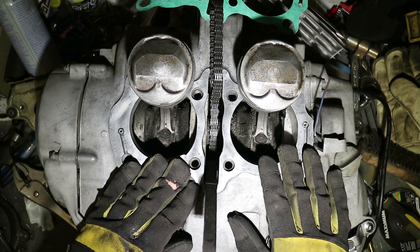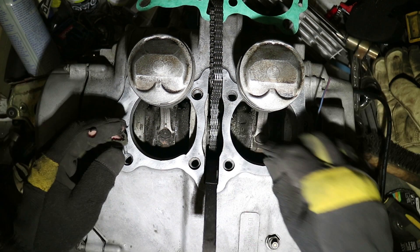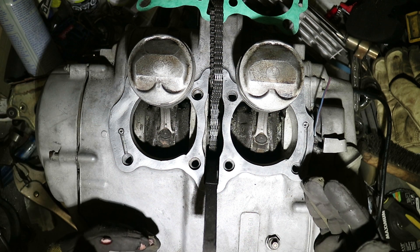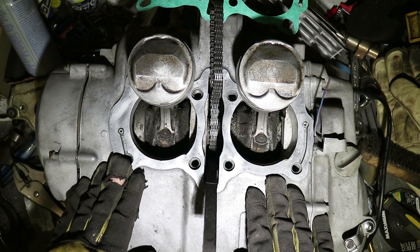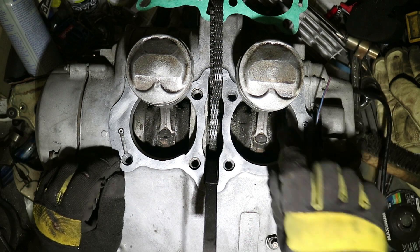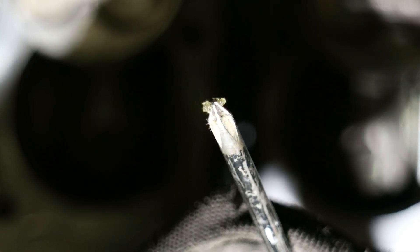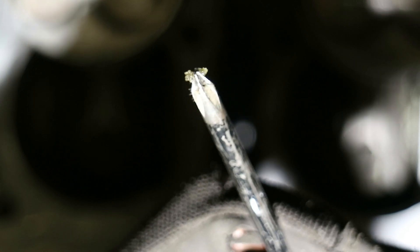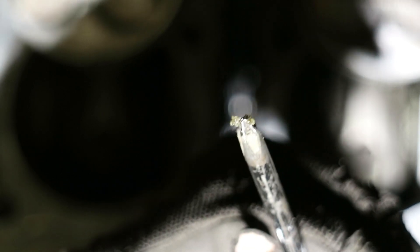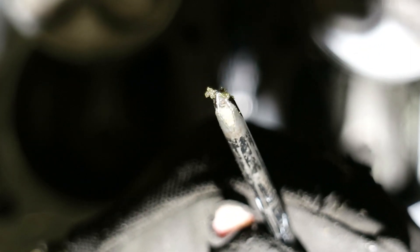As you can see I've gotten all the old gasket material taken away and was sort of in the middle of starting to get things together, and then I just noticed little bits — I don't know if it's metal flaking from previously or if it's sandblasting material that got in. If you look in at the front wall in here you sort of see some stuff. I just poked the screwdriver in and scraped the front of the inside of the case — that's a perfect example of what I see in there. It's not metal; it's got some crystal qualities to it, so it must be whatever media they were blasting with.